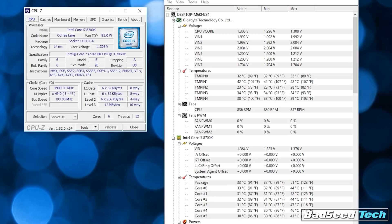What I was able to achieve on this setup is 4.9GHz stable at 1.3 volts in Prime 95 small FFT testing. That saw temps in the mid-80s. It's worth noting that any other benchmark I ran today, including the Adobe stuff, only temped out at around 76°C. 5.0GHz was not stable even at 1.33 volts and the temperatures spiked hard, so I just wasn't comfortable going there. I'll have to revisit 5GHz when we get it on water or delid the chip.